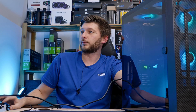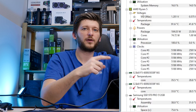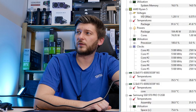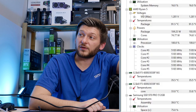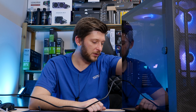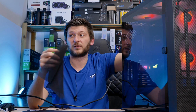The fans are still running at 40% all of them. I'm pretty sure if we set the speed to 30% on the front, top, and back fans, we won't get much of a difference. I can see we're now at 91.5, 91.6, 91.8 — still fine. 91.5, 91.6 — still not a lot. I could probably go even lower. So we did win something. The issue now is I have no clue how much this affected performance, but the new fans definitely did something. We have a lot more airflow going through this thing.